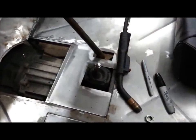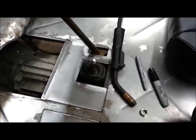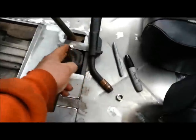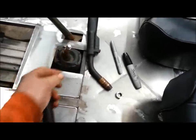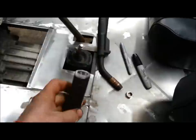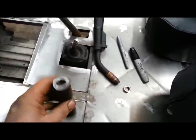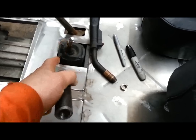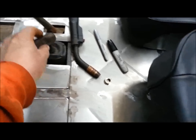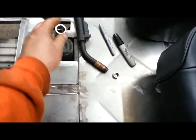Now to the shifter. Now that I know where the steering wheel is, I can kind of figure out where my shifter is going to be. This is some kind of fugly metric-thread rod — I don't really feel like buying a tap, so I made my own collar here real quick. This side here is bored out to 11/16ths, which just happens to slide over 5/8ths. Slides over that just right, and I'll make a set screw — or two of them — and lock it to that stem.